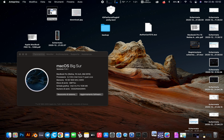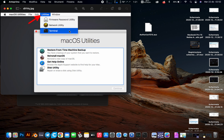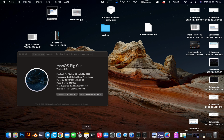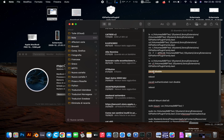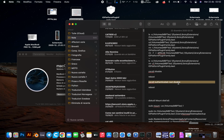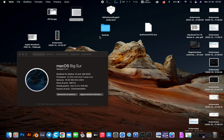Then what you see after the loading is this screen. You go onto Utilities and then Terminal, and then you type into Terminal the following strings. Of course, I will leave all the things in the description of this video. When you have done this, reboot your computer, boot again into recovery mode like I showed you first, and then type in the same thing as I show you here. Then reboot it and boot it into the regular operating system. Well, now we can proceed with the next steps.